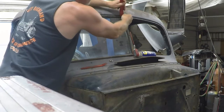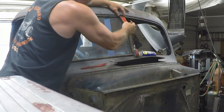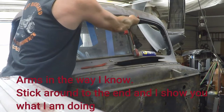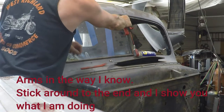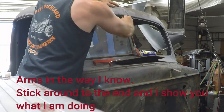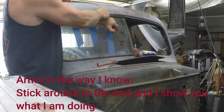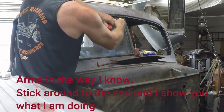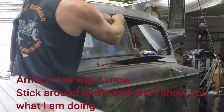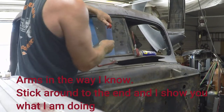We're going to start right here at the edge. Our intent is just to get it below the lip and get it started in there. This will be your hardest part right here, but it will go. It actually just started to go. I'm just pulling this tool along and shoving this one up in there, pushing the lip of the rubber behind the edge of the cab — the edge of the windshield.